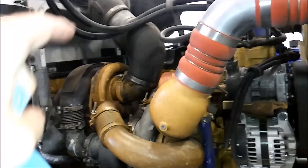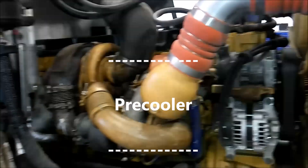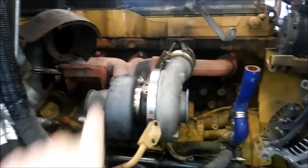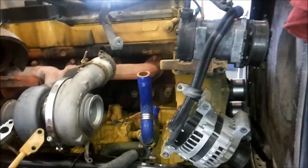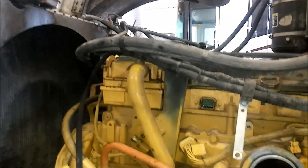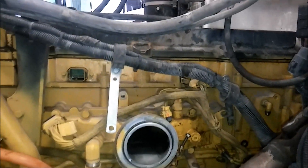The pre-cooler sits right there — it's from the turbo, the high-pressure turbo into the CAC. We have removed the pre-cooler; it was clean, there was no coolant in it. Getting ready to pull the cylinder head, I've pulled the fan drive and the low-pressure turbo. Pull the intake tubing off — the intake is dry, which is also a good sign that the pre-cooler was not bad.